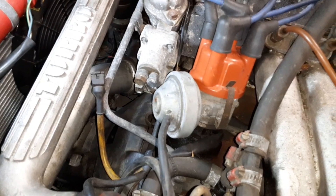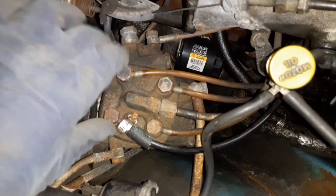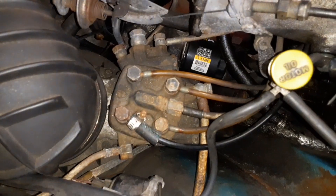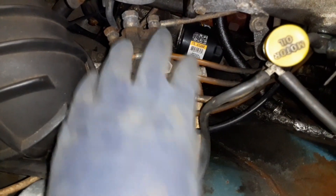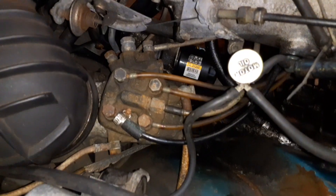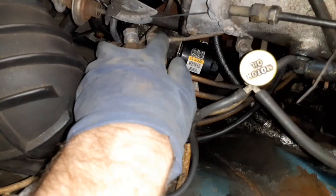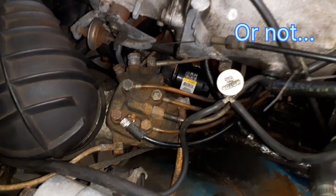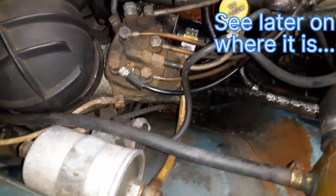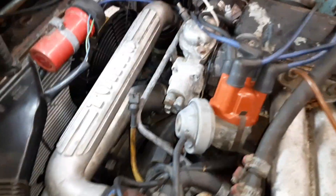We're going to have to do some tests with the actual fuel injection system. This is the CIS or KJetronic — that's a later name for it in these cars. These are lines that go off to the injectors here on the cylinder head or intake manifold, and then there's an input line and an output line from the fuel tank. There's also a cold start injector line, and these two lines go to the warm-up regulator, which controls the pressure. It gets engine heat and basically adjusts the fuel pressures in the system.